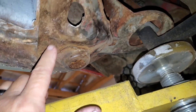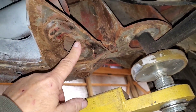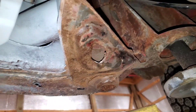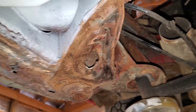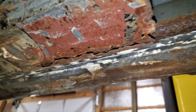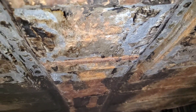This plate over here on the passenger side has a little corrosion hole, and both of them are bent because of improper jacking where somebody put the lift in that area when it's supposed to be on the donut. I'll do the same over here since the pan wraps underneath. I'm going to get my flapper wheel in there and clean all that up, and probably go down the inside of the longs as well to smooth things off. Basically what I'm trying to achieve is getting a score mark across here where the seam will be, and then I can remove all that metal.